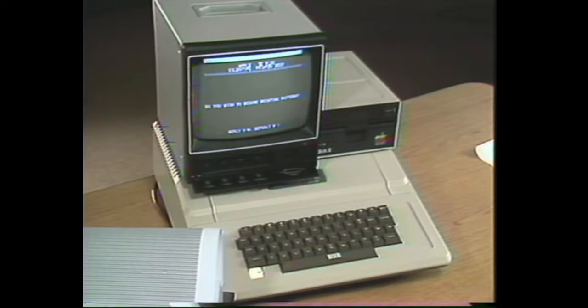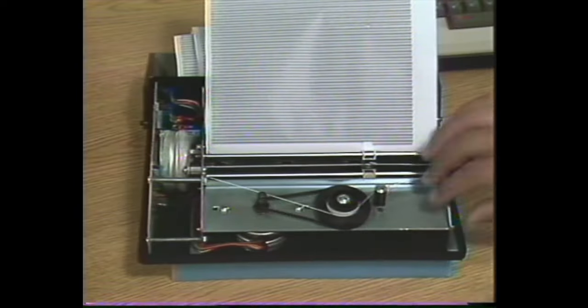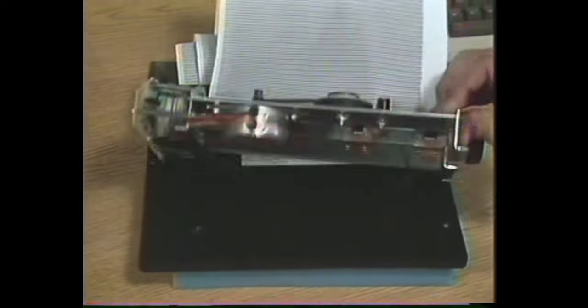One other thing you might need to know is the margin switch. The little margin switch is located on the bottom left-hand side of the printer. You have to look pretty carefully to see it — it's small, but here it is. As the print head travels to the left margin, it comes in contact with this little L-shaped switch, just like that. Sometimes that switch does not come into contact with the print head assembly like it's supposed to, so you can take a small screwdriver and just bend it slightly away from you — just tweak it.